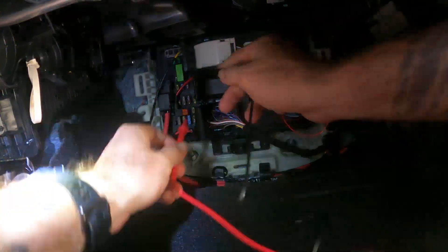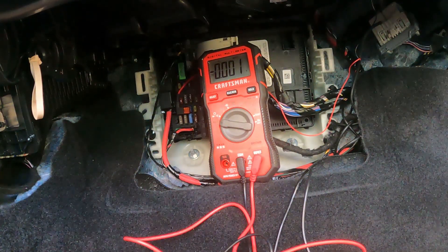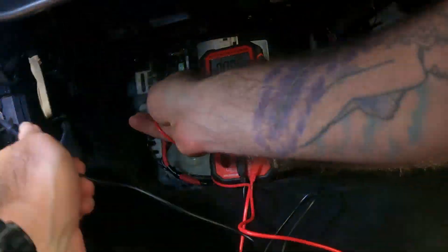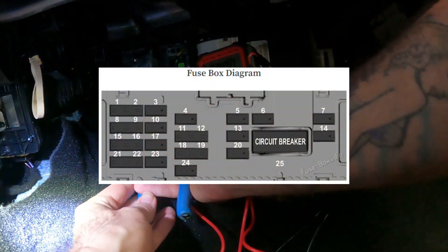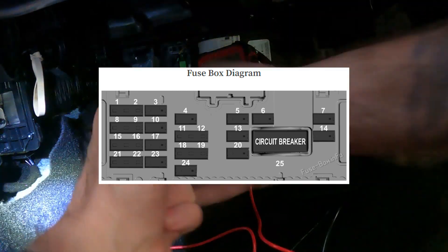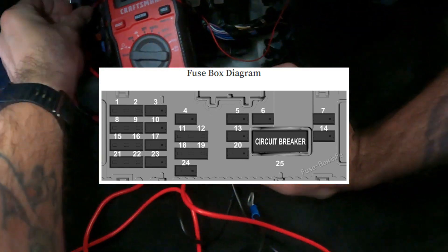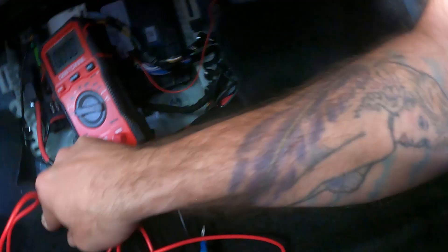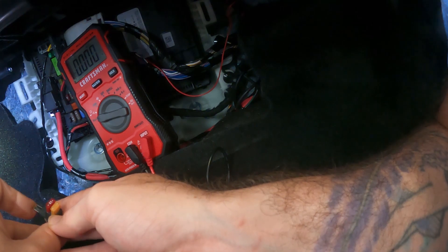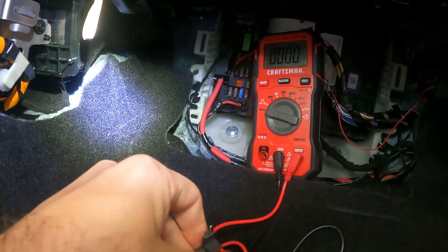What I'm running is power to the power adapter, that way I'll have an extra USB and I'm not going to use the one that's up on the dash — I'll keep that free. So I'm now working in the fuse box. On the fuse diagram, number three and number six are the fuses that turn on and off with your truck. I want this wireless charger to turn on and off with my truck because I don't want a constant draw on the battery. You can see me in the background verifying what fuse is turning on and off with the truck and also which side the power comes in for the fuse.